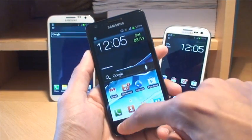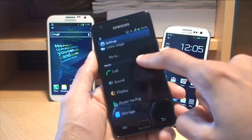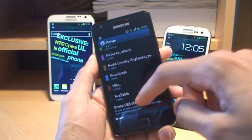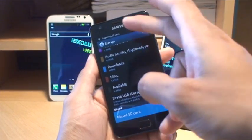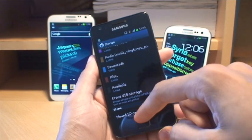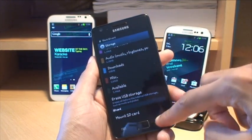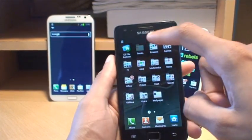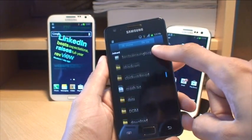So we'll swipe to go in and go to Menu, Settings, then down to Storage. Along the bottom you've got no options at all telling you how much space there is or how much is free — it just gives you an option for 'Mount SD card'. If you press mount it does nothing; it says 'Preparing SD card, blank SD card' and reverts back to 'Mount SD card' again. And if you go through to My Files, there will be nothing there — no option for external SD card because it doesn't pick it up.